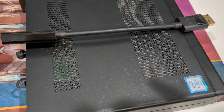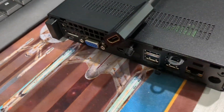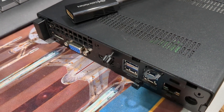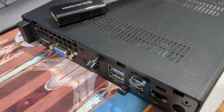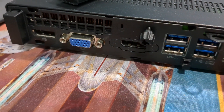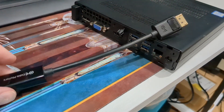The HDMI option board was a bust. I tried it with a couple different distros — it would think that something's there and that data is going to the monitor, but it just wasn't displaying. So I put back in the old DisplayPort and used an adapter to convert it so I could get HDMI.